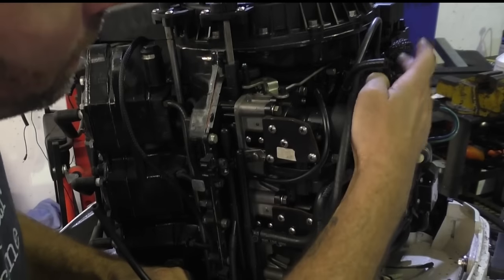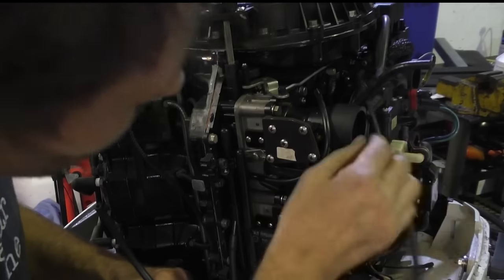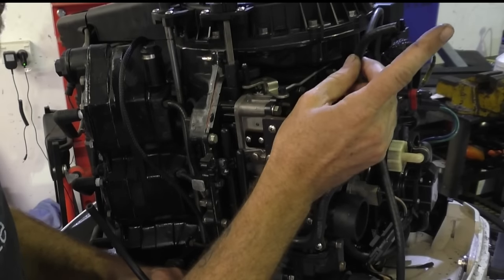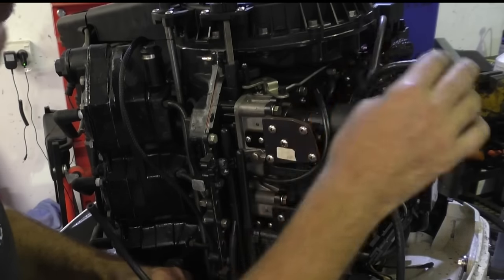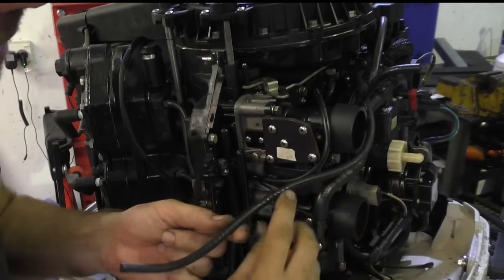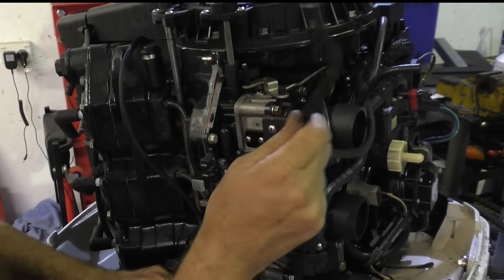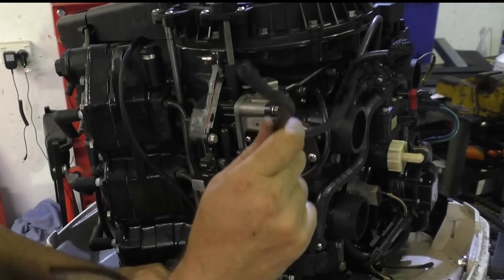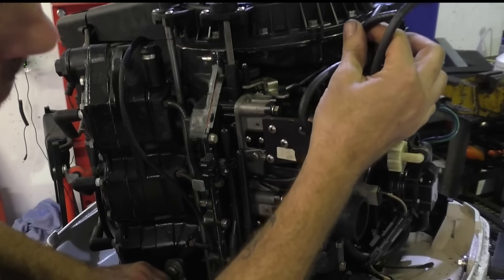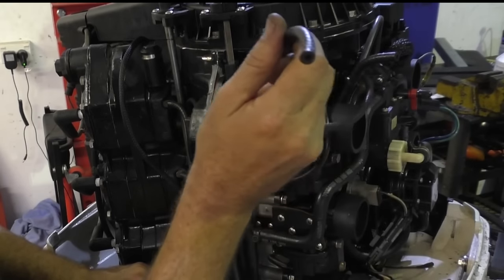On the top here, it talks about a vapour pump. There are two hoses coming out — one goes to a T-piece, which I've seen a photo showing it going into the airbox, so it just takes that vapour and reburns it. There's another one that comes from lower down and I'm not 100% sure where that goes. There's one of these on both sides for both banks of carburetors, and then two hoses that come — well, this one I believe is coming from the vapour pump.